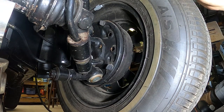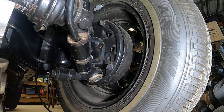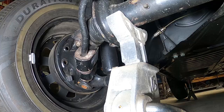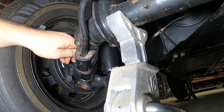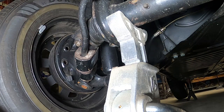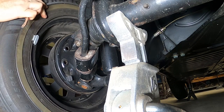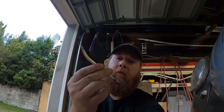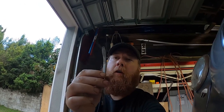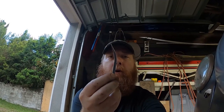That's comforting — at least this wheel was adjusted pretty close to as good as it can get, and now it's in good shape for the brake bleeding process. Same deal over here — tighten the top one and go backwards on the bottom. We're locked up, so we're in good shape. My brake adjuster is just an old broken screwdriver with the handle busted off — I did a little bit of grinding on the tip and some bending, and it works really well for VW brakes.